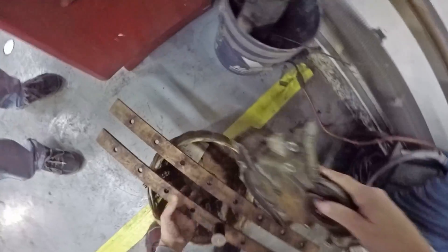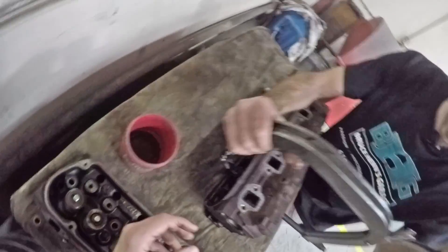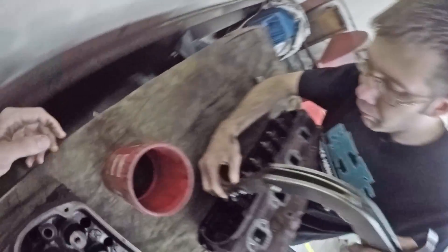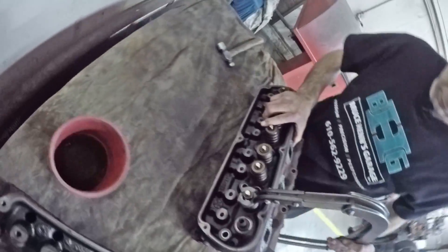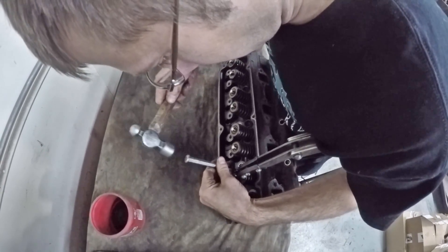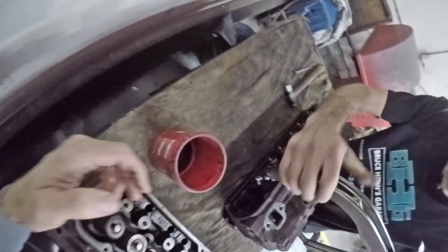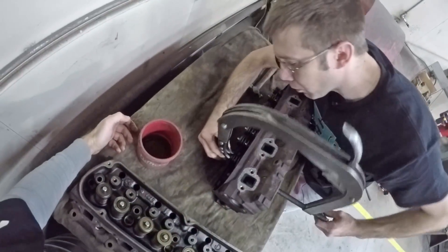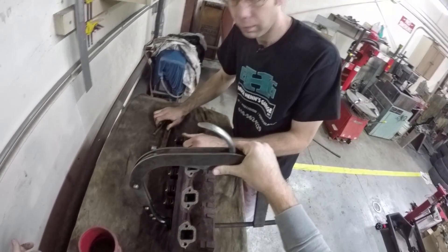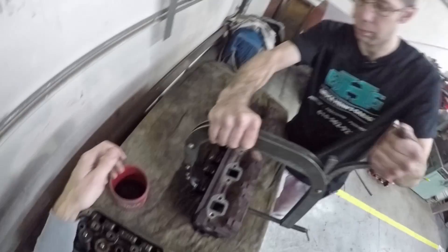There's the old one — don't roll. We'll set that there for all the keepers. Sometimes you have to give them a little tap. This will be the intake. See how that one didn't go? It's a little tap on the side. See how it's still locked in there? I have this little punch — usually just tap them just a little bit. There it goes, releases. Sometimes you have to turn them in a little bit farther so that the keepers will drop out. Just pull that out and release it. That's your intake — just keep going down through.